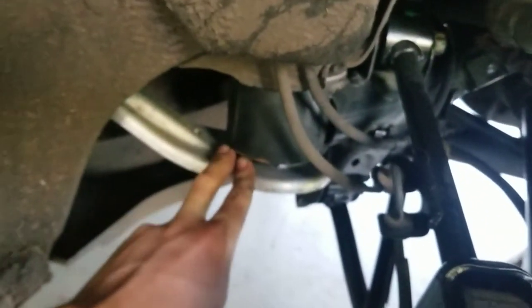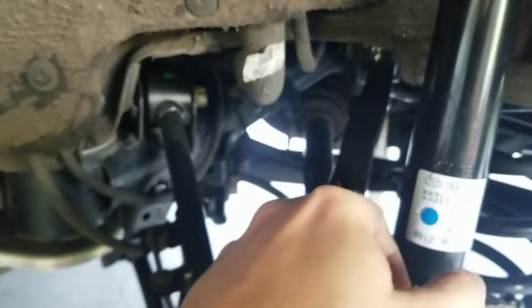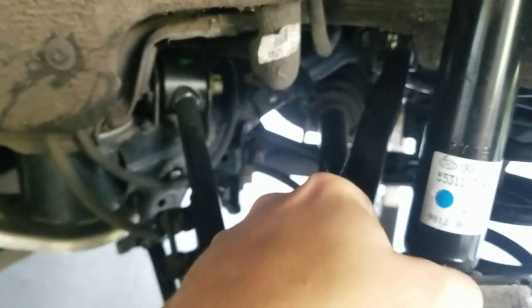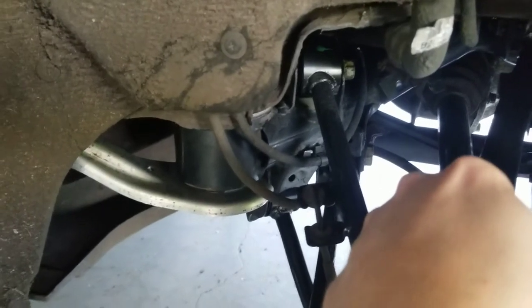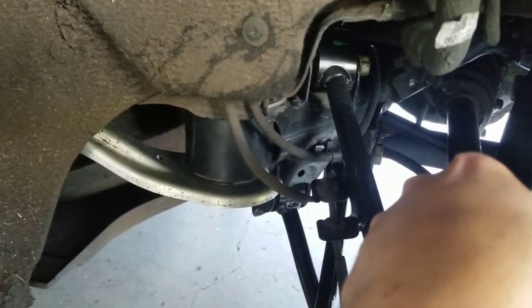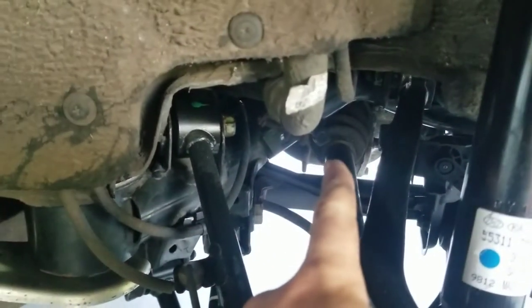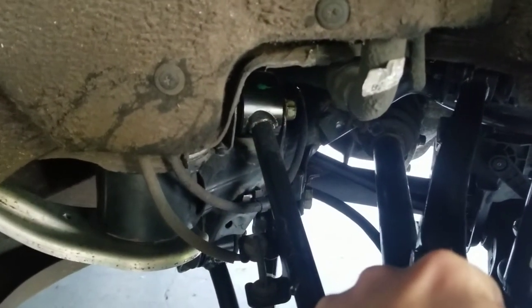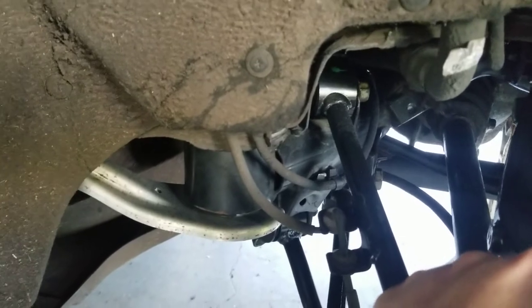There are plenty of videos on the coupes on how to install - basically take the two bolts up here and take that bolt out. I swapped my subframe for a 2012 because the bushings - the differential bushings and corner bushings on mine were pretty well worn. Basically whenever I stopped, the car could booty wiggle a little bit and I didn't like that. I went around looking for new bushings and ended up getting a whole new subframe because apparently these bushings aren't common to go bad, but I live on pretty rough roads. Aftermarket subframe bushings aren't really available - they make the differential bushings but those are about $500 for a full kit versus I got the subframe for about $300 with all the bushings already inside it, and it had around 87,000 miles from a wrecked vehicle where the wreck was on the front, so it was fine.